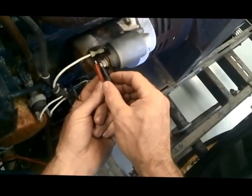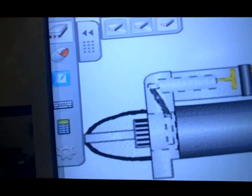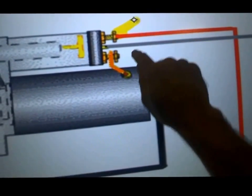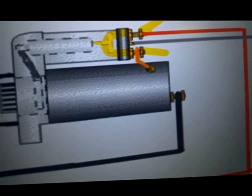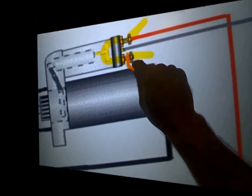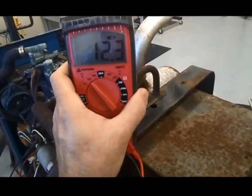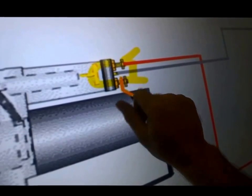I've put these two leads across the solenoid — one lead right there and the other lead right there. I'm going to check the voltage drop across this connection. Since I hear the solenoid engaging, I want to make sure we have very little resistance coming across this connection. I'm going to engage the starter and then read the meter. We have 12.3 volts voltage drop from this connection to this connection — 12.3 volts to make it across that connection. That's how much is being used across there. That's no good.